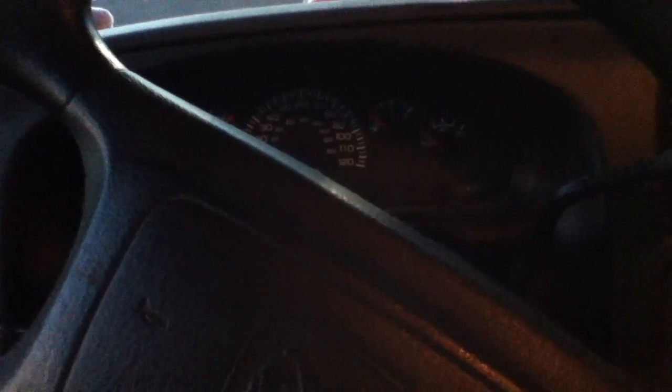So replacing that line, if your thing didn't go bad, but you're having little brake issues with your Dodge 2000 to 2003 Dodge Ram full-size van. My understanding is that the one-ton vans may not have this issue, but the half-ton to three-quarter tons do. If you're having brake issues, check that line over on the driver's side. And of course, if your brakes just died suddenly and they lose pressure, you will not have much brake. It's not like it goes into manual brake mode. You're going to be using your e-brake to stop.